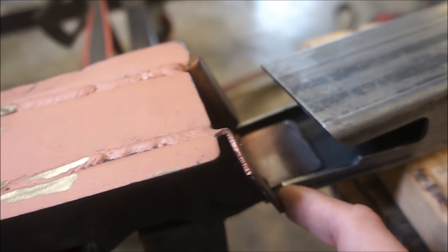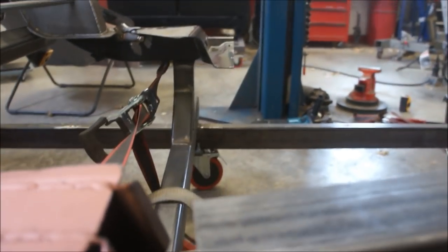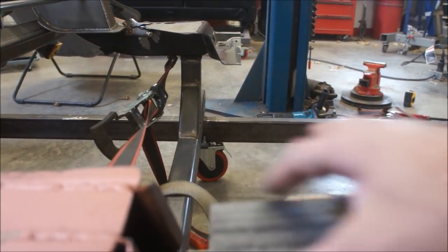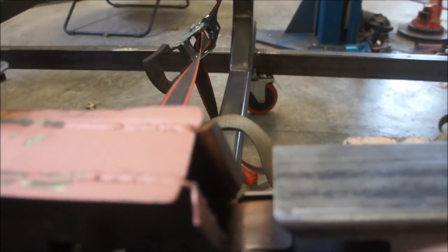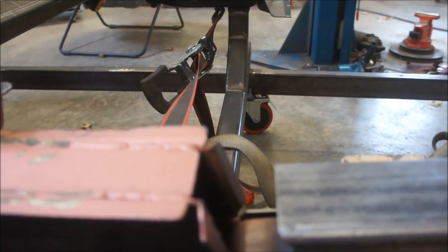But literally, all you're going to have is this one weld bead right through here. That's it. So my thought is, and it's not completely straight and everything, but it will be, why not somehow bring this into your frame to where you can weld it all the way through this square, or at least bring it into where you've got a piece coming into the top of it, and tying it into your frame rails,